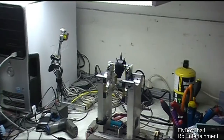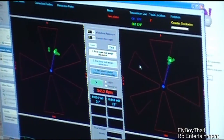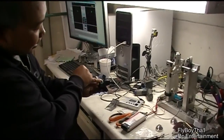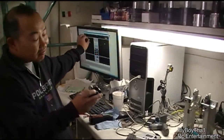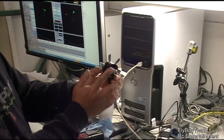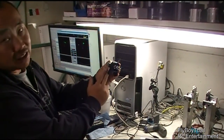He's going to run the rotor on this machine and the computer will tell him when it's balanced. If he has to add weight or remove weight, it will keep doing it until both green spots are inside the center blue line. This tape right here is a reflective strip so the laser can pick up the RPM this rotor is spinning, and the software can calculate where the off-balance is — balanced down to a fraction of a fraction. It will tell me this side and this side where it's off. Most standard balance machines only do static balance, but this is two-point — it balances the rear and the front — that's why you get a smooth-running rotor.